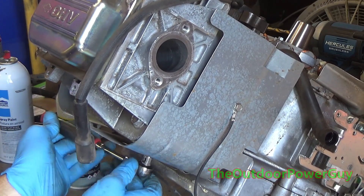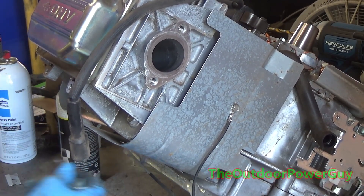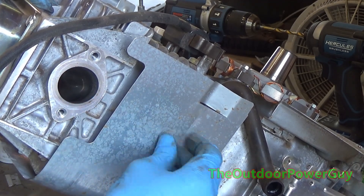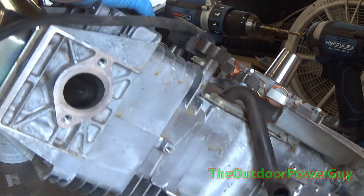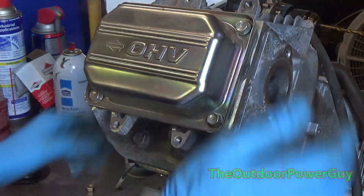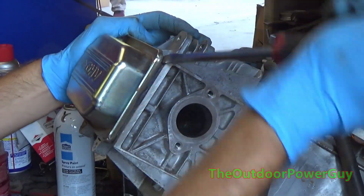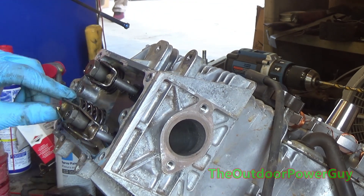In just a moment, we're going to take the overhead valve cover off. Even though I removed all of the oil from the engine, there should still be some left — enough to run out on the table. We're going to get rid of the cooling tins, which are very important, and then remove the entire head. To clarify one thing: Briggs & Stratton no longer uses valve cover gaskets; it's RTV sealant from the factory. When we peel the valve cover off, it is bone dry, which is not a good sign.